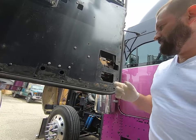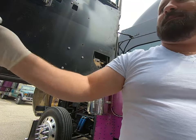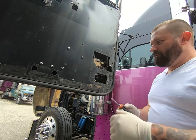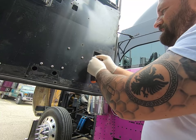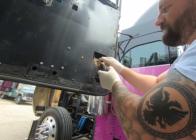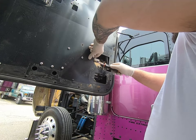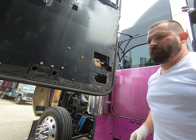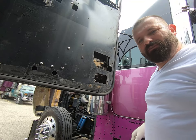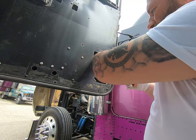I'm just going to change door locks real quick. Got some new ones and got a new lock kit because I think that's what's wrong and that's why they're not opening up. So first things first, these little tabs right here. Be a little gentle with these because they're old, especially if you have an old truck like this one is. Especially if it's something you gotta reuse again. Now this particular one, don't really care, it's gonna come in with the new stuff anyway, but if you gotta reuse stuff, be mindful of it. It's old, it's brittle, and it's probably gonna go to shit.